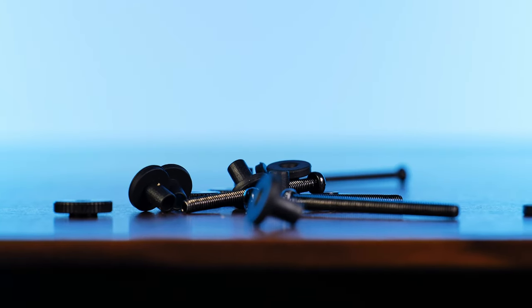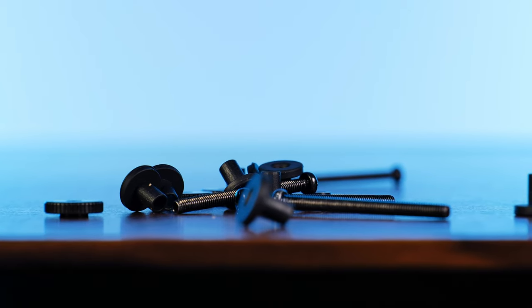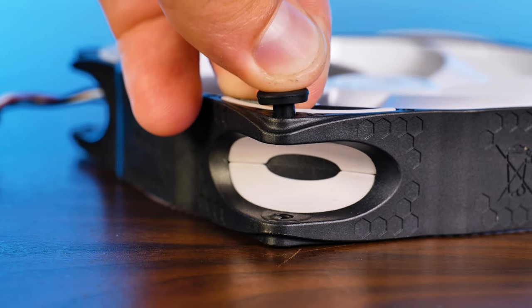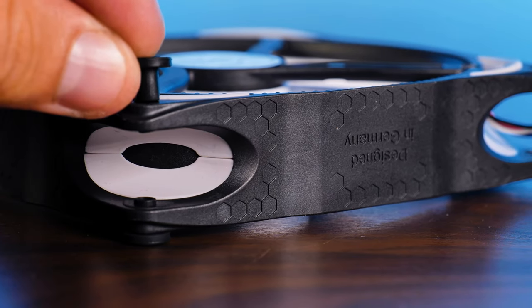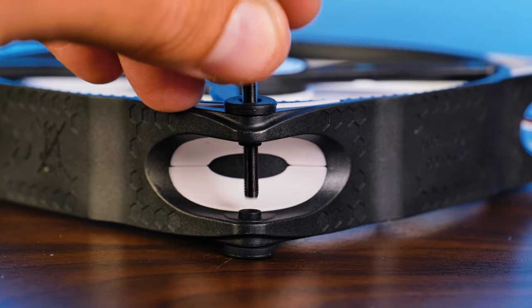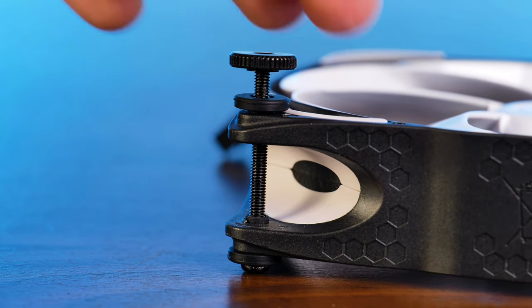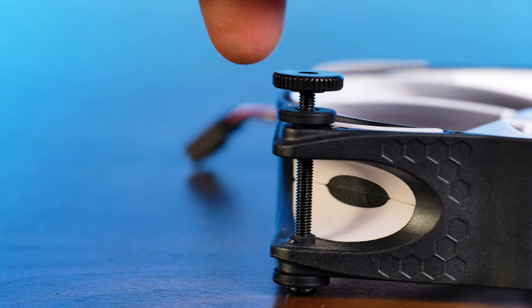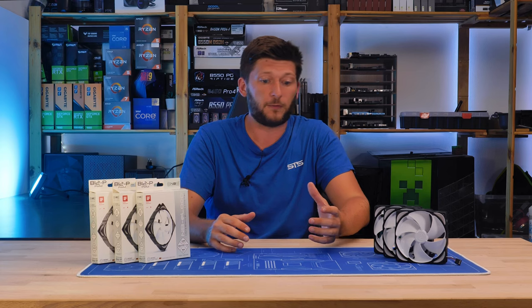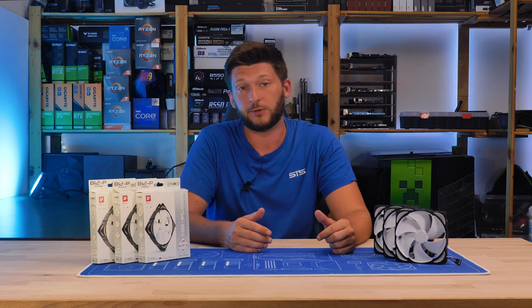For the installation itself, it's a bit different from what we are used to. Included, we get a bunch of long radiator screws, some nuts and rubber washers. To install them, we press the rubber washers into the holes of the frame where we would usually put fan screws, then position the fan, shove that long radiator-type screw through it, and secure it on the other side using the nut. Keep in mind there will be a bit of screw sticking out, as they produced a single screw length for both the 140 mm version and this one.